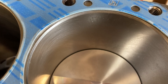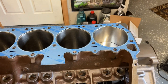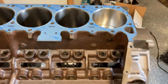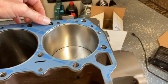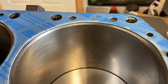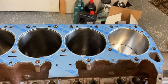I found this lesson out the hard way when I was about 18 or 19 — you can see my old orange cooter there. We just built a 440 for it. I used the head gaskets straight out of the kit, identical to this, bolted it on, and the car would start and run great. I took it out on the racetrack and it would spit and sputter and really act up. I thought it was a carburetor, so I yanked it off and put a brand new one on, tried one from somebody else's car — it just kept doing it. It turned out that when this head gasket was flattened, the firing ring actually just barely hung over the edge of that chamfer. When it hung over the edge and started making power at higher RPMs, it would blow that head gasket — actually probably blow it through there to get a little bit of water in. So when it was blowing that head gasket, the car ran like crap.